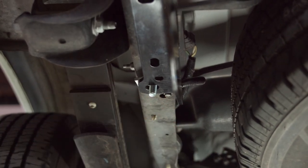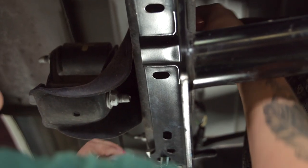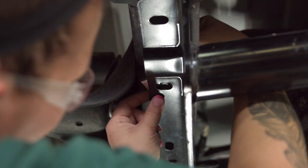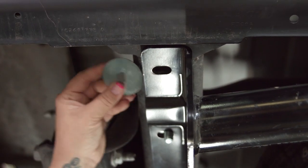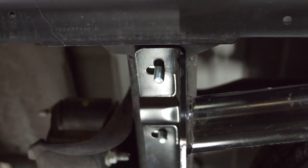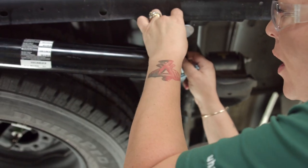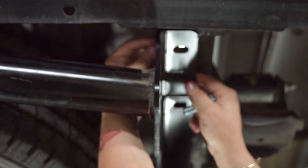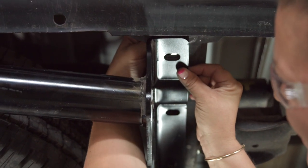You'll repeat the process, then go ahead and do the same thing on the passenger side. In this hitch there are two of these that come with it — those go up in the front. The hardware kit installation will tell you in the picture what position to put them in, so don't get discouraged by which bolt goes where. The instructions tell you exactly where they go.